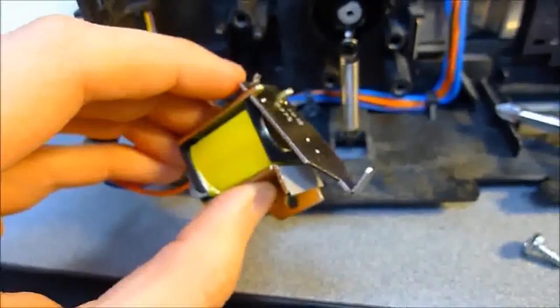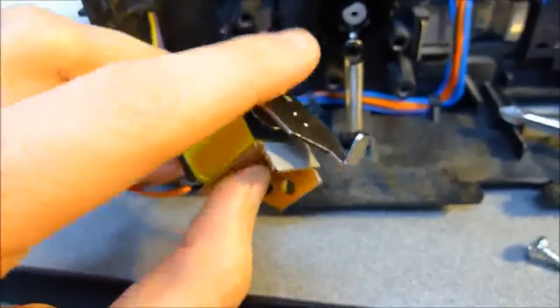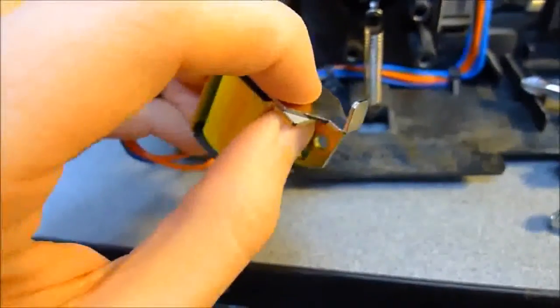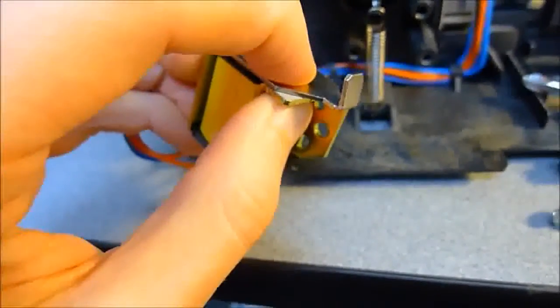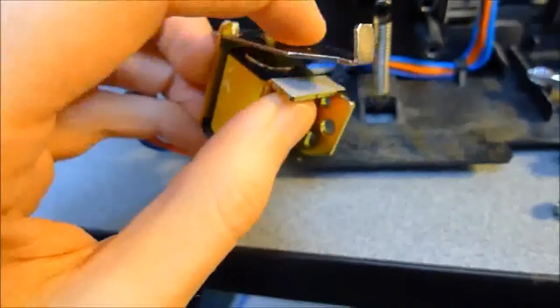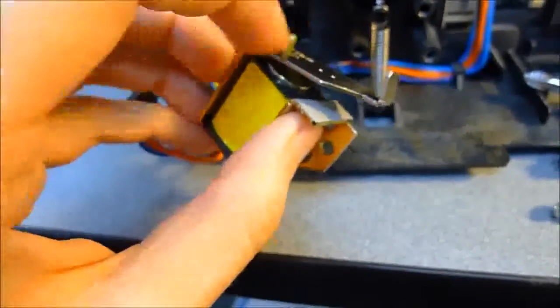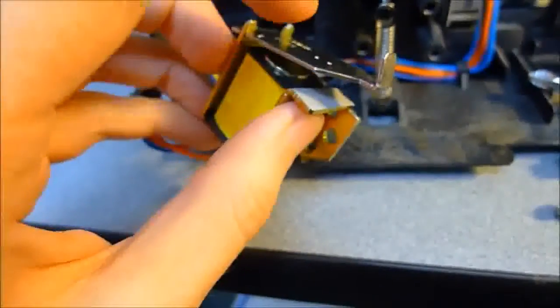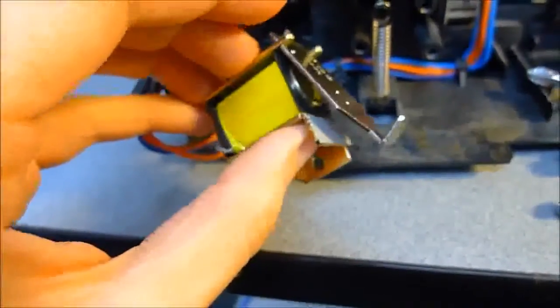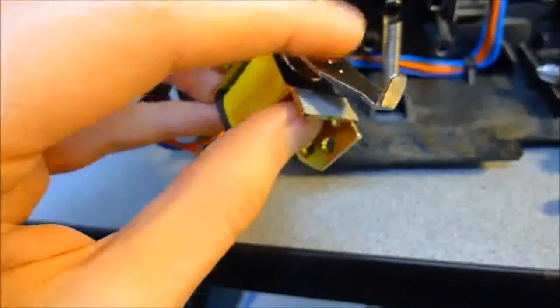Once you've taken care of the other two solenoids for tray 1 and tray 2, right before you put it back on, go on and give it a try. You should be able to press on the armature really hard and still not have it stick at all. That should mean that the adhesive, thanks to the little electrical tape I put on there, is not going to pose a problem, and we're not going to have any issues with residual magnetism either.